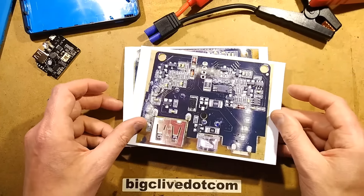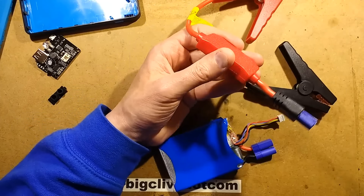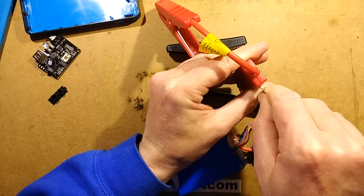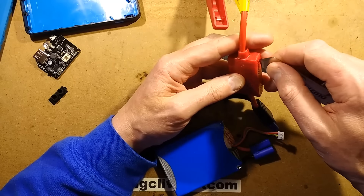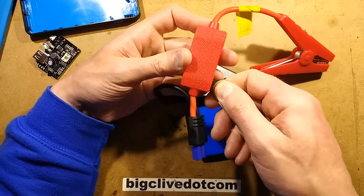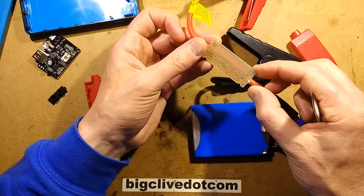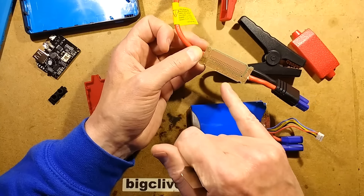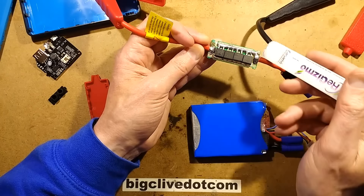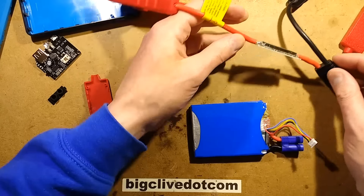Here's the interesting bit - let's open the diode pack. This is the bit designed to stop the alternator, once the engine is started, from back-feeding into the lithium cell and overcharging it. Popping this open, it's a very similar construction to the other one I opened, except it's all on a circuit board with lots and lots of ventilation holes - or possibly plated-through holes for coupling heat. It's a single-sided board with no real major heat sink, and I have to say I tested this and it was leaking current in both directions - I get the feeling it's already somewhat toasted.